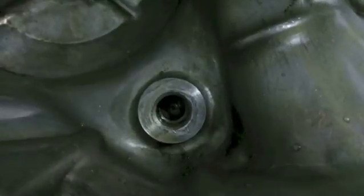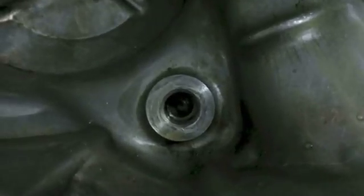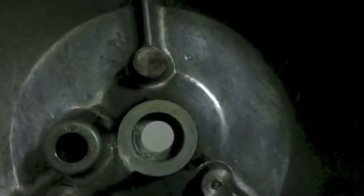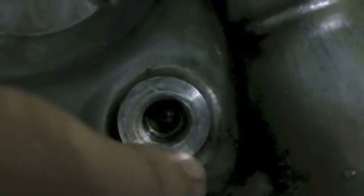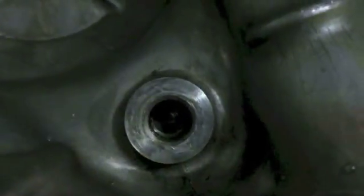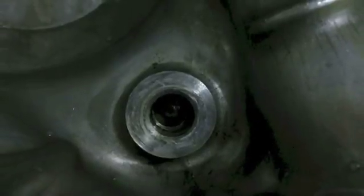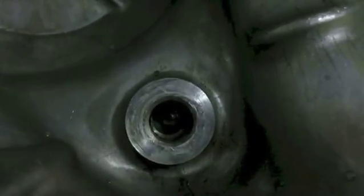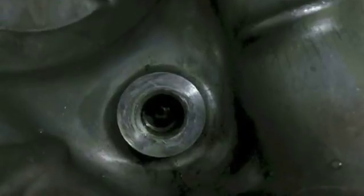The cover I was originally going to use on this one was a lot better, but I think I just gave it away to somebody. But anyway, I used that cover, and that one had a perfectly round hole. In fact, here, I know this is not the same instance, but you can see this hole. Take a look at the center, how it's just completely circular. But then you come down to here. Even if I center myself, you can see right here, it's worn out a bit. As I said, this one is a bit borderline. I know it'll work fine, but in my personal taste, I don't like to use stuff that's about this worn. If I had a choice to purchase a new one or a good one, I would just go ahead and do that.